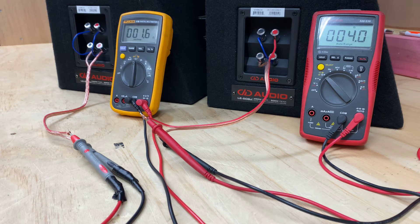Don't get too worried if the reading's fluctuating. We are dealing with coils, so you can see it's varying on the red from 3.8 to 3.9 to 4 — that is a 4 ohm. The one showing 1.6 to 1.5 and varying — that is a 1 ohm load. There's always going to be little variances, but at least this gives you a guide. If you're running the red multimeter wiring setup, you'd be running a 4 ohm monoblock amplifier. If you've got a 1 ohm monoblock amplifier, you'd be running the yellow multimeter wiring setup.